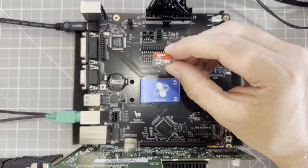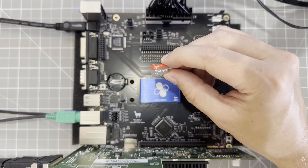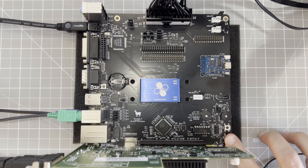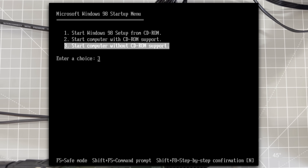With the BIOS in place, it's time to prepare the microSD card with an operating system. We're going to do this using the ITX Llama's virtual floppy drive. In goes the microSD card, and power on. When we boot the Llama, we press Escape for the boot menu, then 2 to boot from an integrated Windows 98 startup disk. The Windows 98 image was flashed to the system on module with our custom BIOS — it's period appropriate, supports large FAT32 drives, and is real DOS, so it'll have great compatibility for our DOS games.